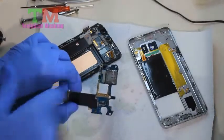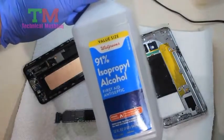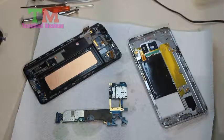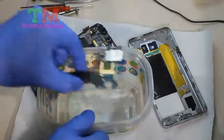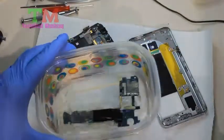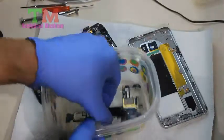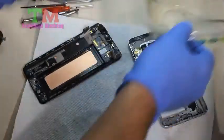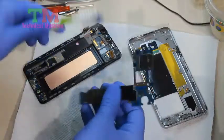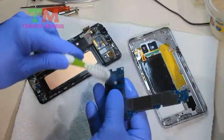You can still see a little bit of damage here. What they recommended — and what we're going to do — is get out rubbing alcohol at 91% or higher. A lot of what's out there was 50% and 70%, so we went and got the 91%. We dropped the motherboard in a dish and swirled it around, putting a lid on it because this stuff does evaporate. We did this for probably 10 to 15 minutes, then used a soft toothbrush to clean up the connectors and get as much of the mineral deposits from the water off as possible.